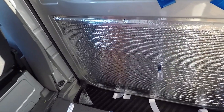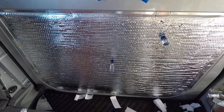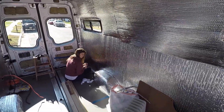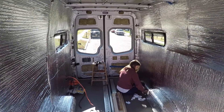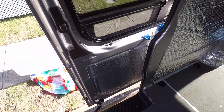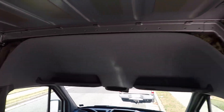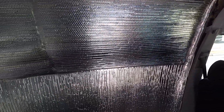I just got the insulation done on the door. There are a couple of holes in the frame where you put your panel, so I just got a screwdriver and made sure I pushed through all of the holes so I don't lose them. The insulation with Reflectix is done. We still have to do the back doors, so not 100% done, but it looks pretty good. We have this side door done as well — we put Reflectix behind the headliner. Over here we just have regular foam; we might seal that off or we might not.